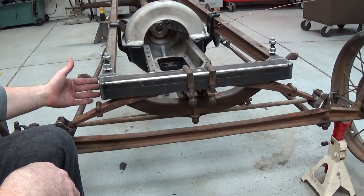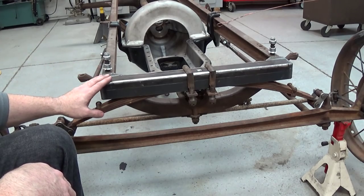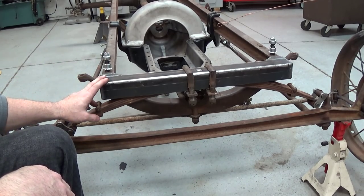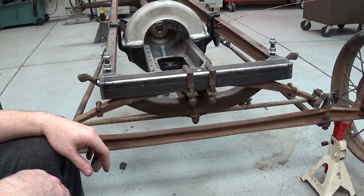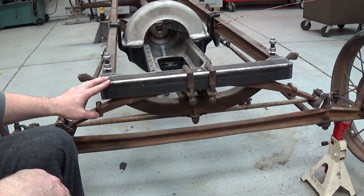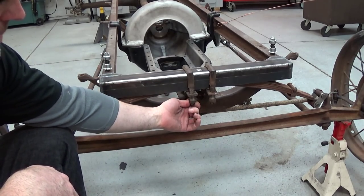You're also moving the front axle forward approximately three inches, and when you do that your wishbone won't fit into the bottom of the oil pan anymore. So we did the old trick of splitting the wishbone and putting Model A tie rod ends on it, using tie rod balls from a Model A catalog. We made some brackets — which is exactly how the original builder did it. We can actually see the rivet placement in the picture: the plates that hold the tie rods are riveted to the frame, just as they did originally.